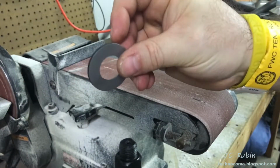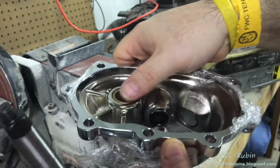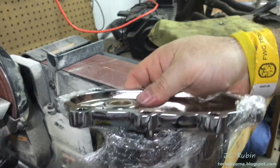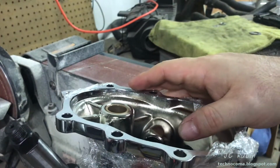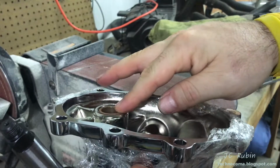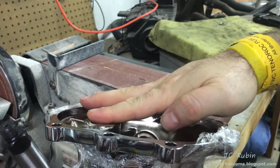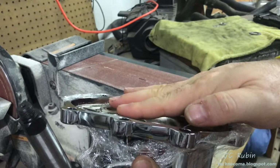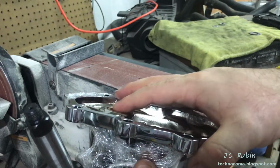Do you solve it by adjusting the bushing, or do you solve it by adjusting the end here, which seemed to be a little bit off? Now, I was corrected by folks on the Shovelhead forum, and thankfully so, that this right here is pretty much the most important factor. The distance between the flat over here and here is what's going to set up the gear to the other gear on the transmission itself, so that has to be maintained.